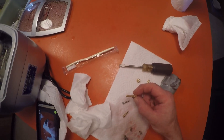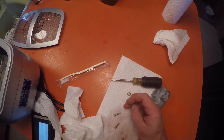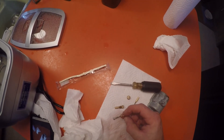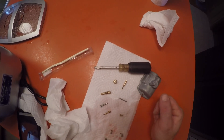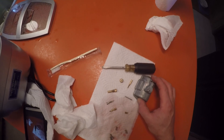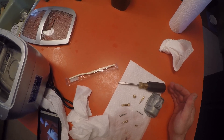Looks really good - the jets are completely blasted free of all that green corrosion and crud. There's a little bit of discoloration because it's old brass - this one's from 1980, the very early 80s - but what I'm after is to make sure all the passageways are opened up completely and the internals are spotless. The needle adjustment valve looks okay - I'll probably take a little piece of Scotch-Brite to it to polish it up. Everything else came out nice and clean. In the next video we're going to go through tuning a small dirt bike engine just like this.